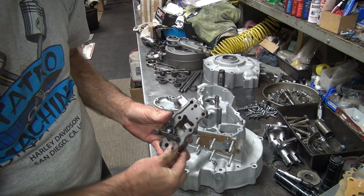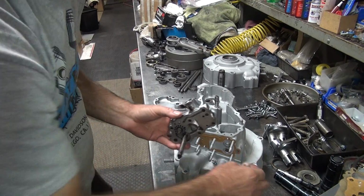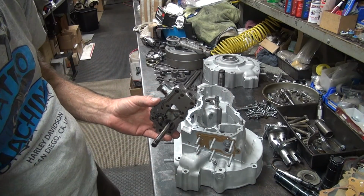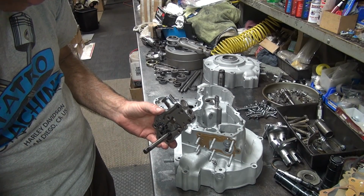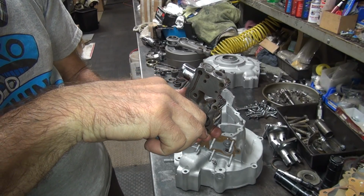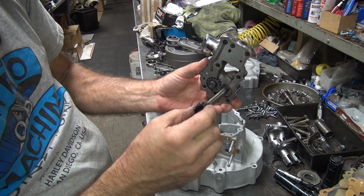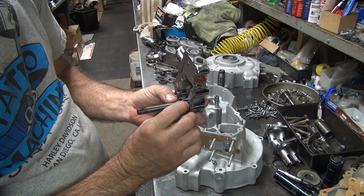Okay, give me a key in here now. Take one of those little small half keys. There it is. I'm also going to drop down to a brown gasket on the cover. That's going to take a couple thou off of that one. That should help tighten it up too. Of course, that might induce another problem. I would never do two things at once. Not me.